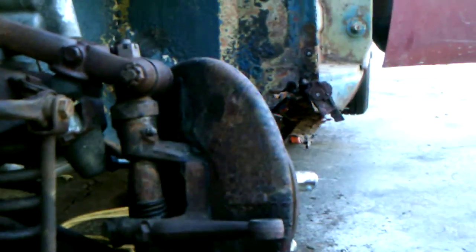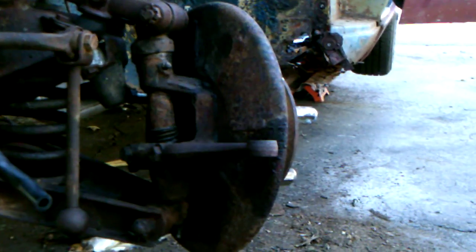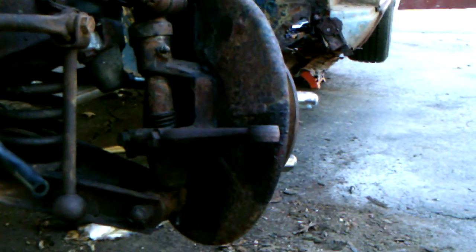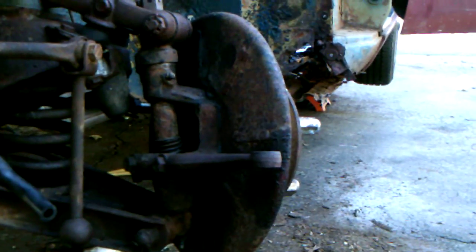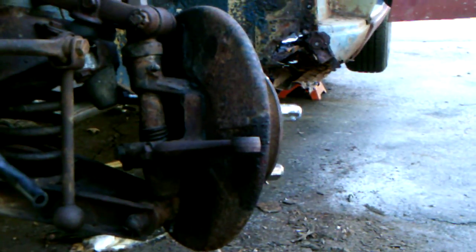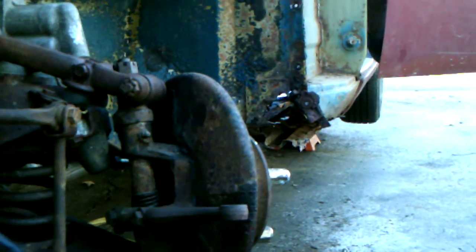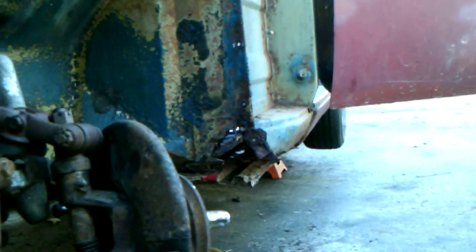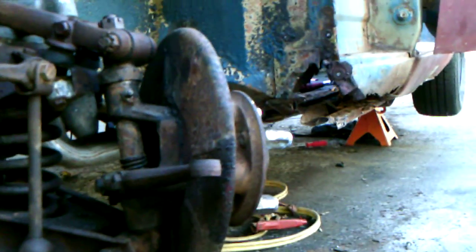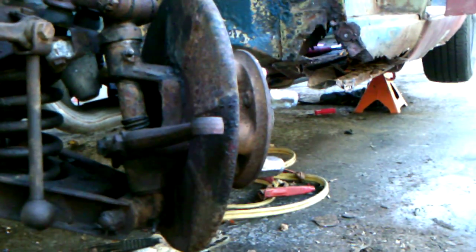And that's the Society of Automobile Engineers. And that's a standard that was developed actually right after World War II. The British and the Americans, we both made some of the same stuff. Some of the tanks that were British were made in the U.S. Some of the fighter planes used the same engines. The P-51 Mustang used a Rolls-Royce Merlin engine that was actually made by Packard under license. And what they found is in field work, the nuts and bolts were not quite interchangeable. Even though they may both use 18 threads per inch, something like that, they would not interchange because the depth of the threads were slightly different.